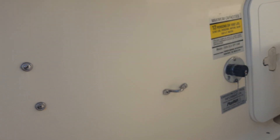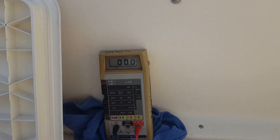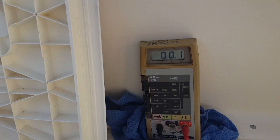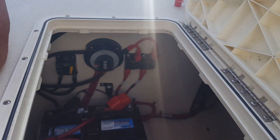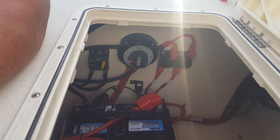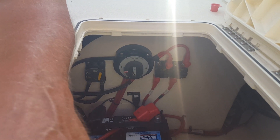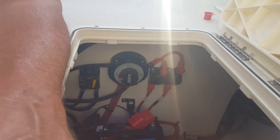I'm going to have my wife show you the numbers on this multimeter. Right now I am on battery one — we're on one, not on both. Now I'm going to show you the multimeter voltage. On our engine running, it should be somewhere over 14 volts.